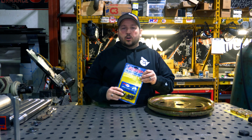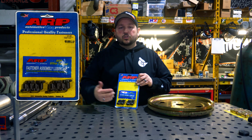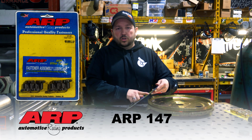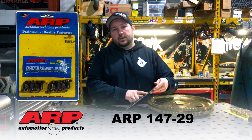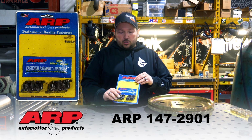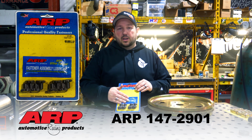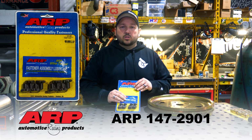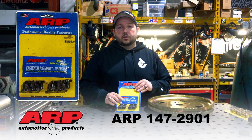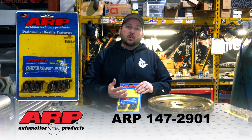If you're wanting to use ARP crank bolts, these are the bolts that go from the flex plate to the crankshaft, and the part number is ARP 147-2901, and that is something that Firepunk has in stock, but you can also order these through anybody that's an ARP dealer. It is something that is not necessary to use on your standard trucks, but for trucks that have high horsepower, we do recommend going to an ARP bolt so you can get more clamping force for your flex plate to crank holding power.